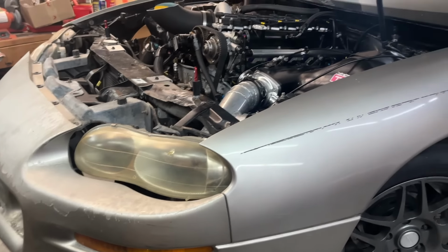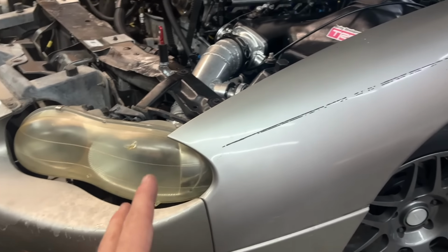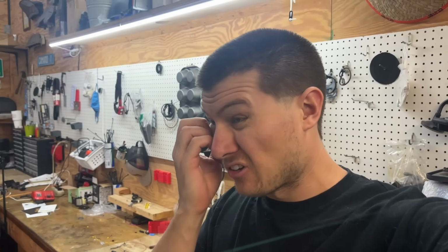All right, so Alpha's been logged into the computer. He's been remote tuning this thing for like 4 hours now, just going through the sensors, configuring all the buttons, the screen, making sure everything works. We're still trying to figure out a few things. Then we're gonna test everything, make sure the coils and the injectors all fire, and then we can do first startup. So we're getting close.